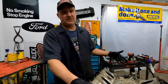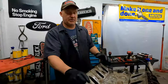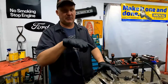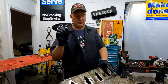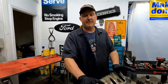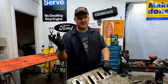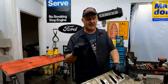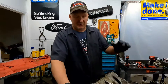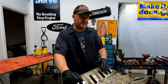To get this far, I pulled the oil pan off. Sure enough, no big chunks in the pan, but if you run your finger through the bottom there's a little stream of very fine aluminum particles — so most likely cam bearings. I pulled one main bearing down and it looks great. I pulled one connecting rod down and it looked great also. So I'm hoping the crank is fine and that the lower end is okay except for the cam bearings.